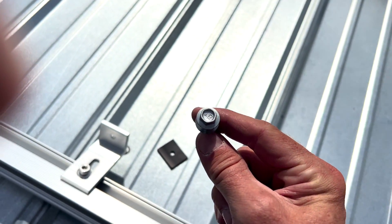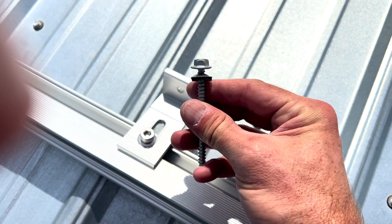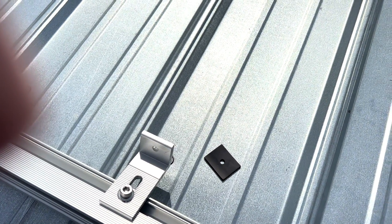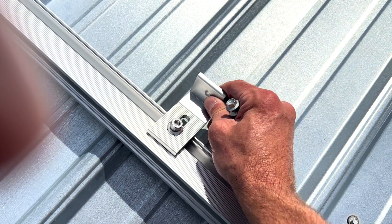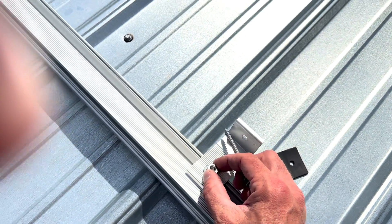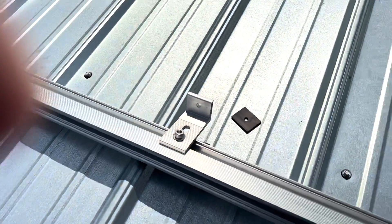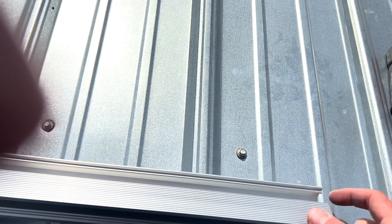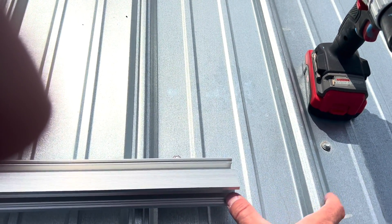These use a 10 millimeter socket. So the only things you'll need are a six millimeter Allen wrench and a 10 millimeter socket to put these roof screws in. If you've got it in a drill, it'll be easier. When doing this, I'm going to loosen these a little bit so I can slide the foot to where it needs to be, then once that part is screwed in, I'll tighten them back down and snug them up with the Allen wrench. Also, as you're putting the rails up, slide those brackets that hold the two rails together all the way into one side first — because if you butt the two rails up together, you won't be able to get that bracket piece in between them unless it's already slid in there.